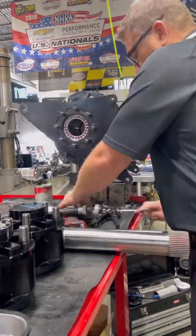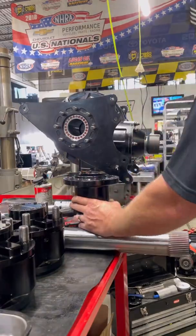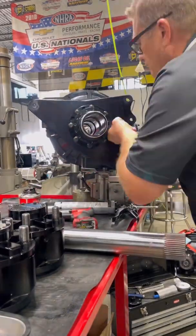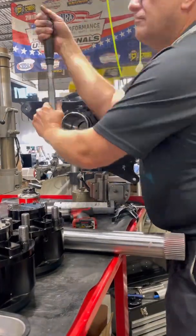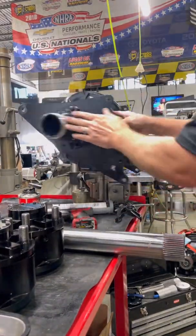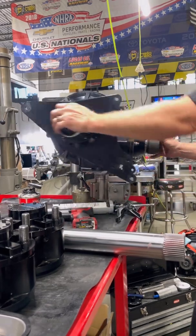Normally when I train someone to do this, it's usually done by either the clutch assistant or the clutch person. I made a book so I try to idiot-proof everything — it goes down to backlash, torque specs, and what to look for in the rear end when you're rebuilding it.